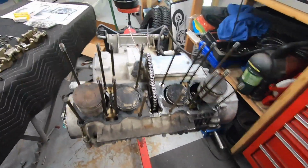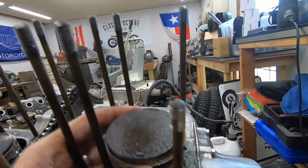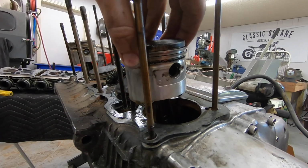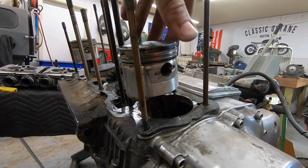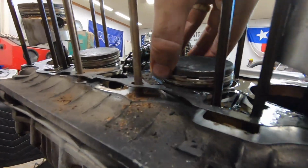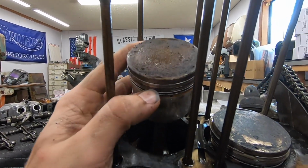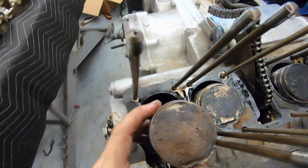But one thing I did notice, okay, number 1 cylinder right here, the piston and the piston rings, you can see the piston rings are loose in their ring lands. They're able to float around, they're springy a little bit, so they actually spring out when it's in that cylinder, push against the cylinder wall, and give you good sealing, aka good compression. And they're nice and free on all of these pistons, except for number 4, which is our problem cylinder.